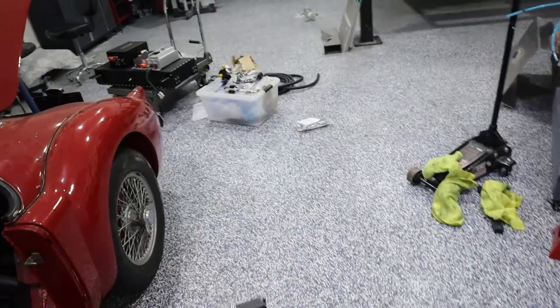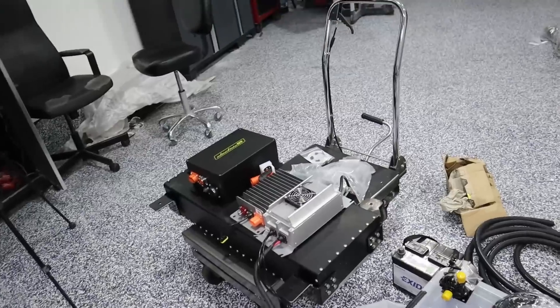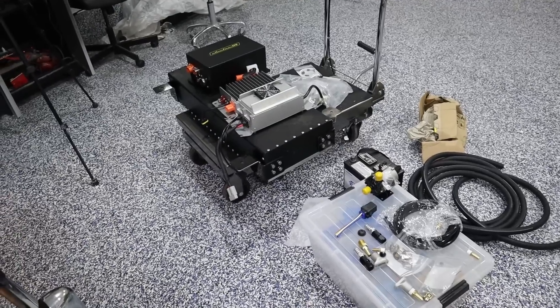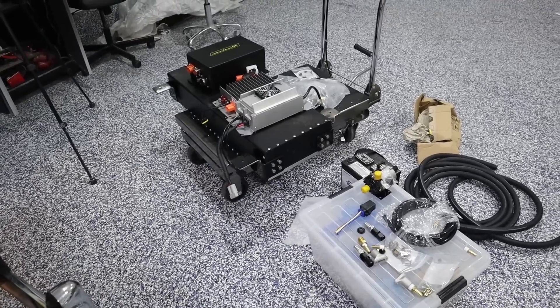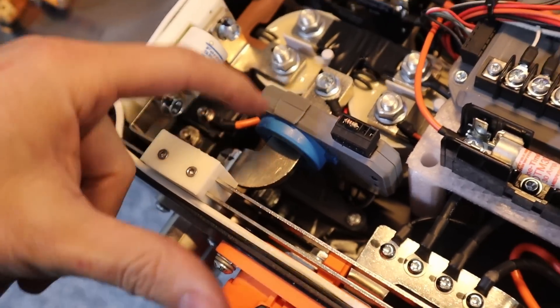The goal is to get it running and driving. It's obviously got a long way to go on its restoration, but it's looking really good, and I'm just here for the electrical part. This conversion was already started — they've got battery boxes, a high voltage junction box, a charger, and a DC-to-DC converter. My job is figuring out where these components should live, wiring everything up, and making sure everything's talking and working. The plan is to get this kit working with minimal help, since the original company is no longer there for support. We've got more episodes on the way — see you next time.